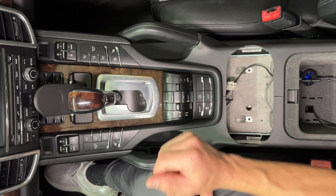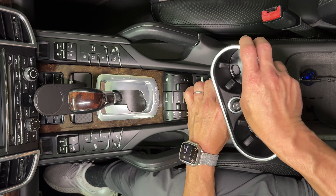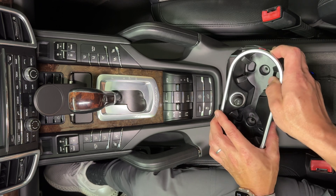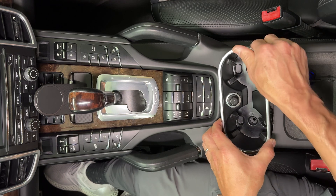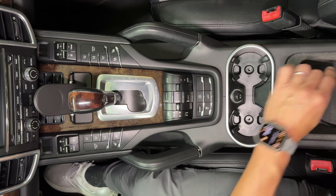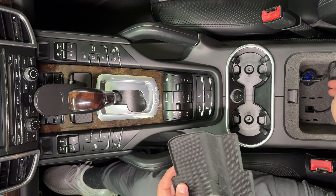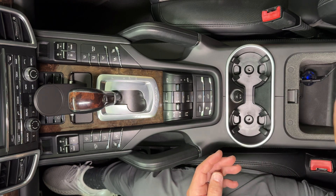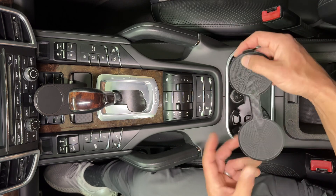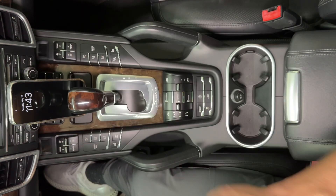Make sure it's all working, then go ahead 45 degrees clockwise to lock it — it's not going anywhere. Plug in the box: get the lighter part in first, get this half in and twist around, then get this other half in. If you want to keep your little pad here, loop it off to the side and slide it in — you'll still have a little mat in there. Put your screws back in and there you go — all set.